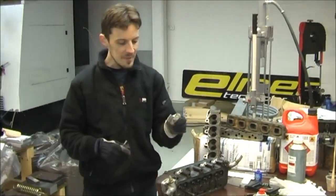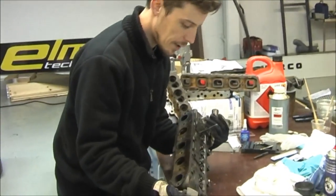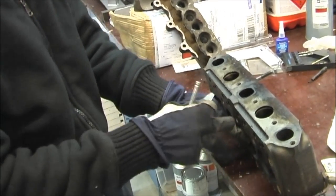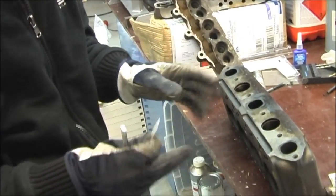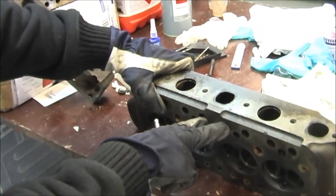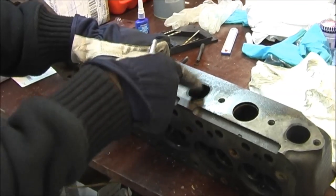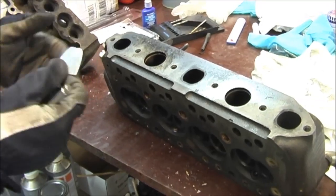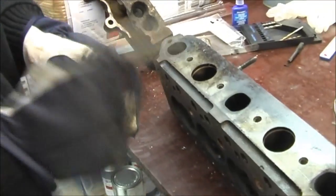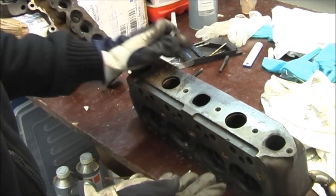It all comes down to this: the stock cylinder head — and by extension the camshaft — has a centralized exhaust port shared by cylinders two and three. We found that the spacing between the pushrod holes for the exhaust valves on cylinders two and three was big enough to fit a sufficiently large port there, allowing us to split it up and still have enough flow area for both. So we have a groove in the head where a plate goes in, and with that layout we can get four exhaust ports on the stock exhaust side.